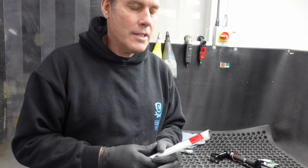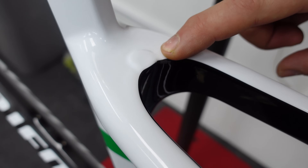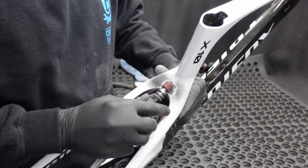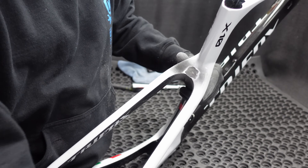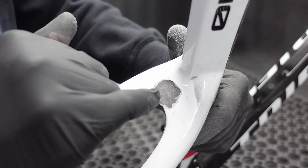These forks are good — the design is probably old style, but good. In part one of this two-part series we discovered the frame was built using an adapted rim brake mould — this used to be a rim brake section which they filled in. Looking at that section, it's just folded with carbon. What you see here is nothing except carbon — there's no hole.